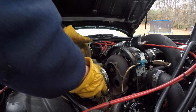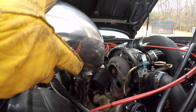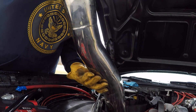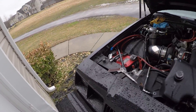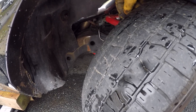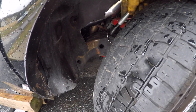I am blown away by the difference here. Check this out - the corkscrew gets a little tight, comes back out - look at this - corkscrew goes back down, works it out, fits right in. What a difference. I'm actually kind of feeling bad that I hacked my car the way I did with the other pipe, because with this one I could probably still put a full hand in there. Although the suspension is at half droop right now with it jacked up a little bit, the control arm is not even touching it - whereas the other one was sitting on it the whole time regardless of position.